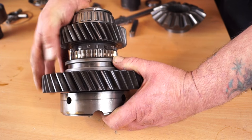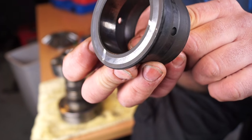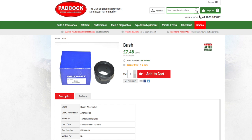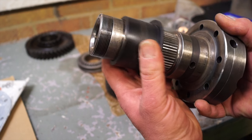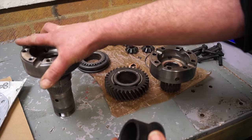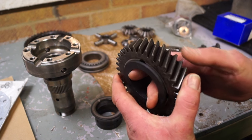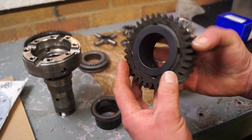You remember we had play on the high selection gear — this was due to a worn bush. You can see the wear on the inside of the bushing and also on the outside. We did a little bit of a search and came up with the right parts from Paddock, part number 100050. The bush is very inexpensive, although it is a special order. Here's said bush — it's actually fitted the wrong way around at the moment just to see if it fits well, and it does. It's taken the slack up completely on the diff carrier itself. We'll check it against the inside of the gear, and that's a nice fit as well — not tight and not loose. So we can keep our gear and our diff carrier without worrying about it being too sloppy.